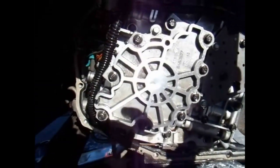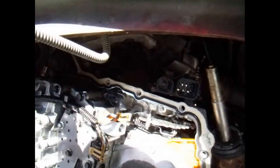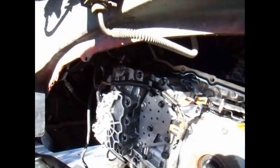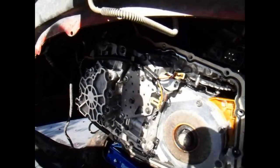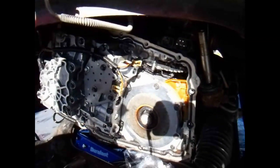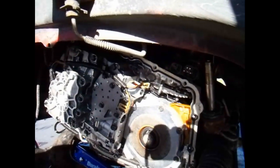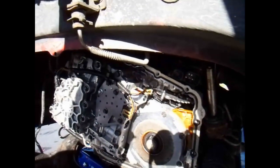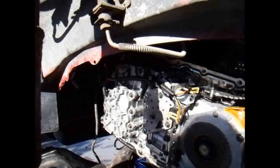Alright, I've got the pump all torqued down and all the connectors connected into the transmission. Got that snapped in, put that fastener in — there and there. Got my park pawl put in there as well and torqued that down. Now I'm ready to install the case cover and then kind of move along from there. I'm going to go ahead and hook on the case cover and then start getting this thing jacked up and putting all these extra connectors and the linkage in for the steering.